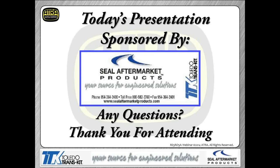So what does that come up with? Well, we've come up with 3 different ratio combinations for all these vehicles. There's only 3. So if I swapped and put a B ratio transmission into an A, the computer is going to give me ratio codes for every gear except 4th, because 4th gear is a 1-to-1 on all 3 of them. So these are the 3 different ratios that you'll find.